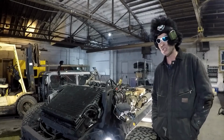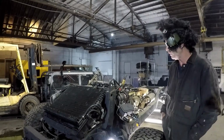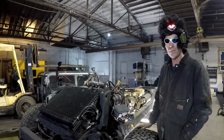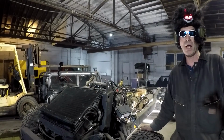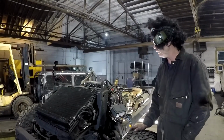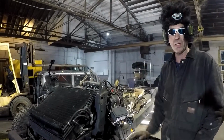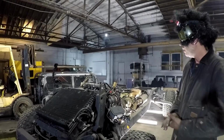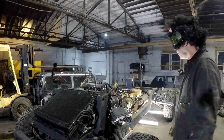I mean, you can actually pull a trailer behind this at 70 miles an hour and never have to worry about it overheating, unlike the 6.5 or 6.2 or even the 6.5 turbo diesel. If you put a trailer behind them, they're already hot before you even put a trailer behind them trying to run highway speeds, if they're capable of doing that, like the civilian version. But with this new improved version, you have a cooling system that works really well. You don't need any crazy jack shaft like an Alpha. This works as good as, if not better than, any of those other things.